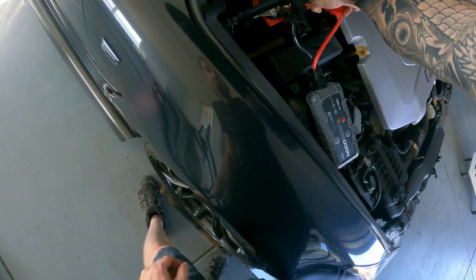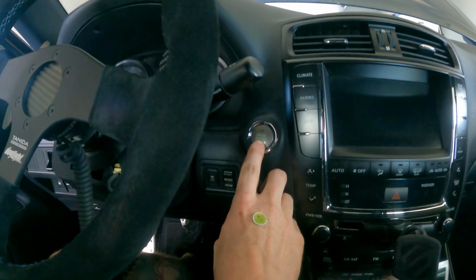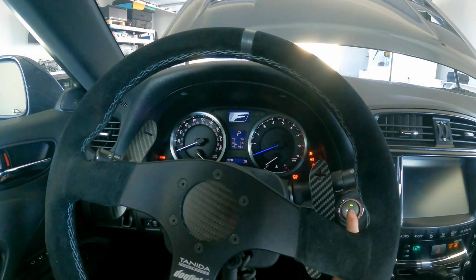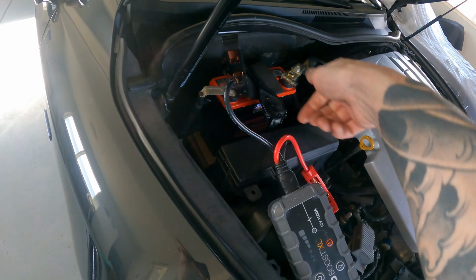That's when I discovered that the angled aluminum I used was much too short, causing the lip to buffet at anything higher than 40 miles per hour. So while I waited for the longer aluminum to arrive, I reinforced the front of the splitter to the bumper just so that I could drive the car a little bit more at faster speeds.